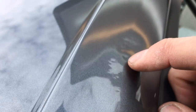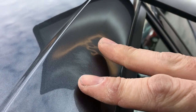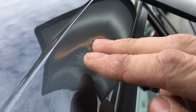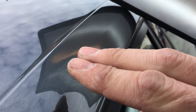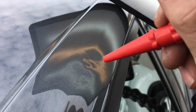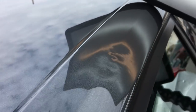You want to be able to pull all the way around this. Because as you knock down the metal on either side, that metal is going to feed out — it's going to feed into that low and away from the low. That's what we want to try to do: feed some of that metal into that low as we open it up. Don't just get in the center and open it. Get in the high and push so it blends it out and pushes into it and away from it. That's slowly going to build up the rigidity in the center, and then we'll come back and take care of all the other stuff around.